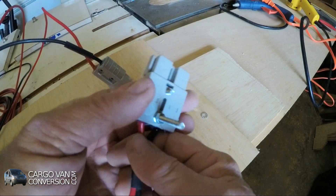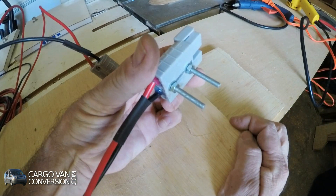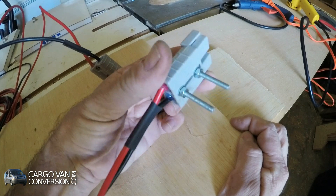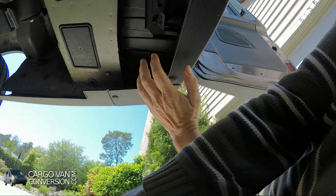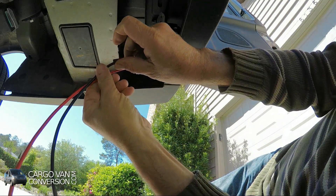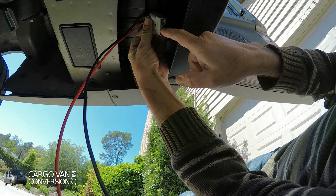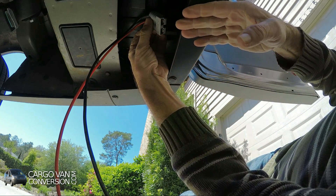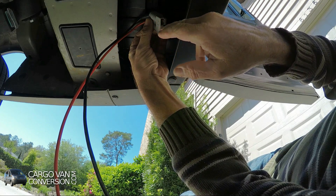I got two bolts to attach to the frame with a washer, then I find a place on the hitch to attach it to. To connect the extension cable to the batteries I needed an exterior plug, and I found a good location at the rear bumper. There's a clip on the bumper which is an ideal location — it's easily accessible, out of view behind the bumper, and there's no dirt while driving. And of course there's easy access to the inside of the vehicle.